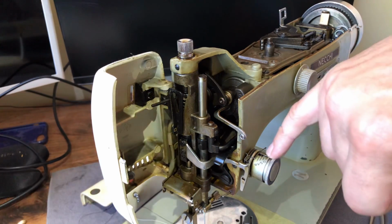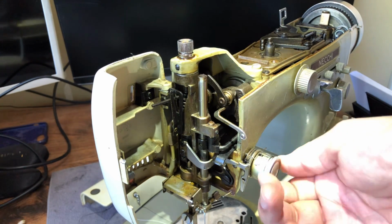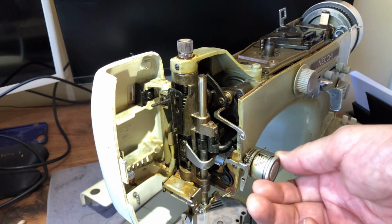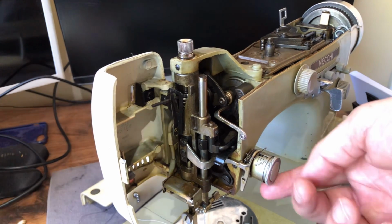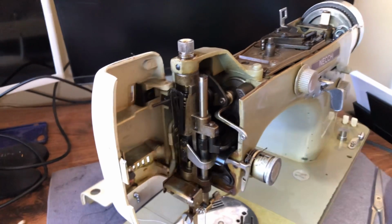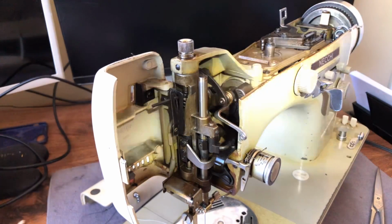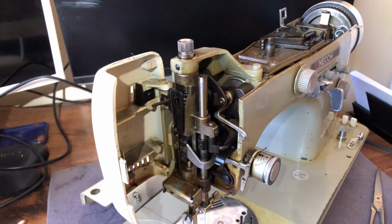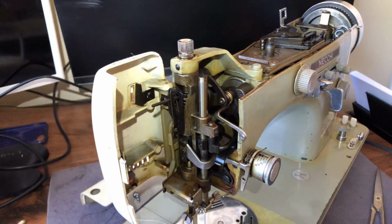There should not be any oil put into the tension assembly from out here. Now, when it's disassembled, that's different. The assembly design you're looking at was not the first Necchi assembly design. I've seen this mostly on Necchis, and a few FOFs used it. It is one of the most refined, and I would imagine very expensive tension assemblies ever created.